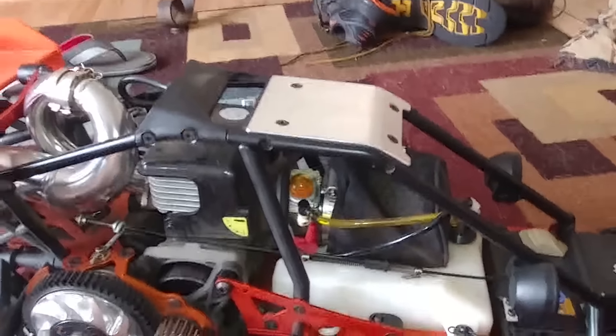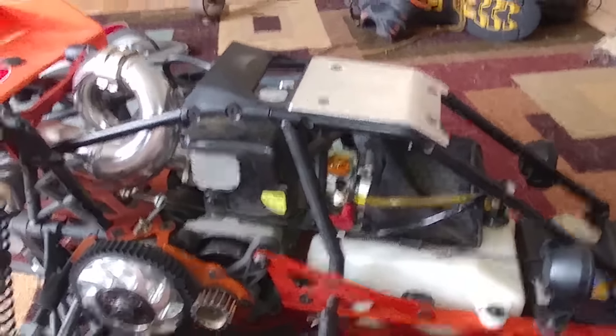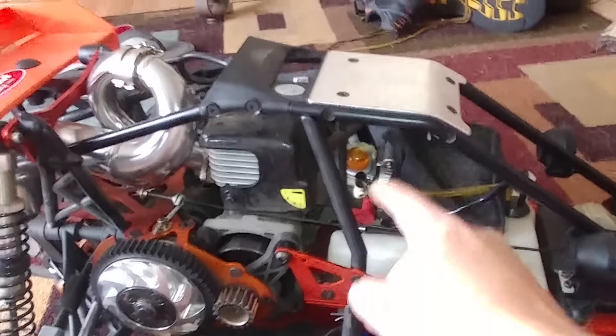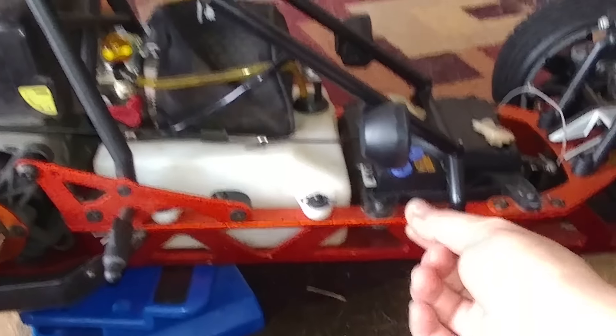With carburetors on fifth scale you never want to keep gasoline in it for long. It'd be okay if the gasoline has no ethanol, but ethanol actually damages the seals. The fuel pump is actually inside this carburetor — it's built into the bottom side of the carb.